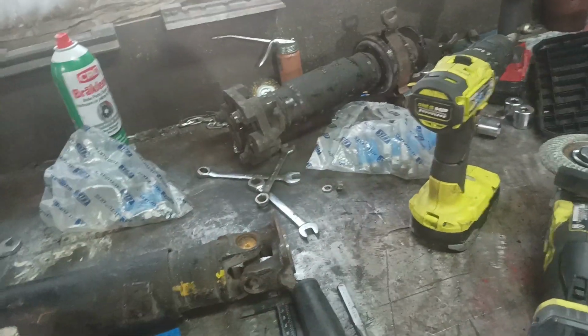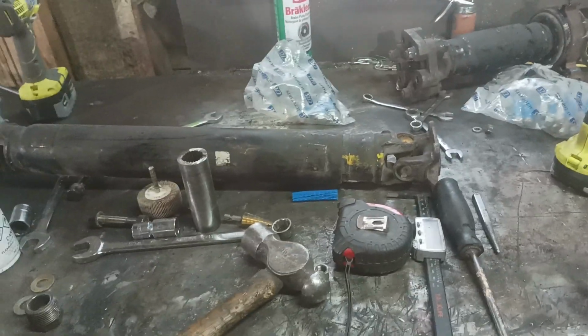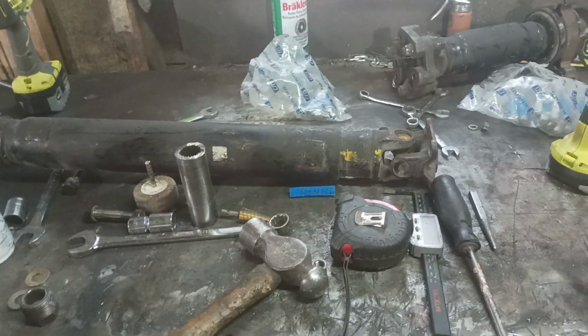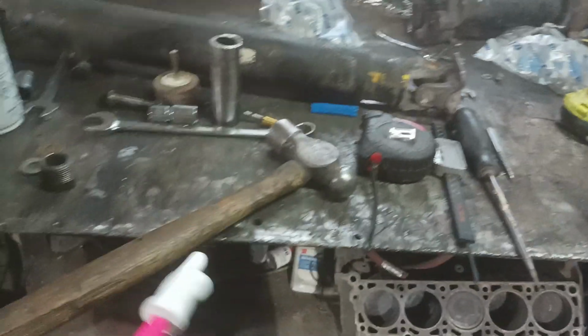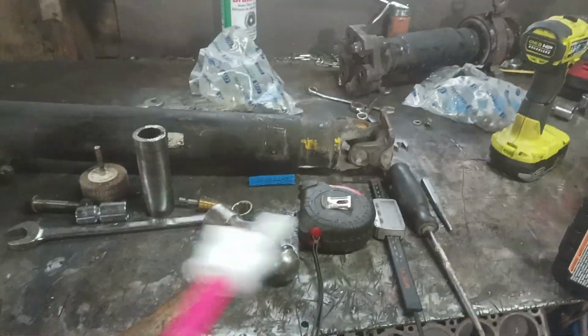So my driveshaft length needs to be about 52 to 53 inches because the MT82 is pretty stubby, and I don't really want to run a long driveshaft, especially in an independent rear suspension car. There's no need for such a long driveshaft. You can get ones that are strong, but we're going to be using OEM parts, so they're not going to be driveshaft parts. So a little bit of a shorty shaft is going to be helpful.